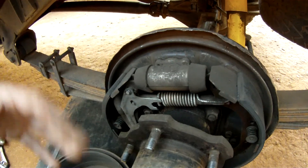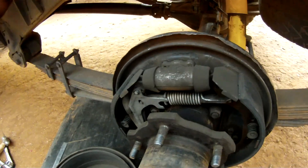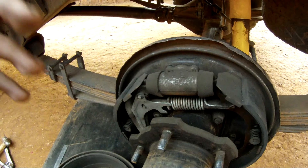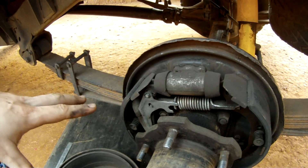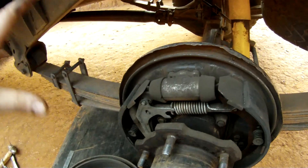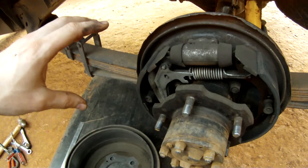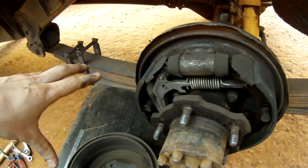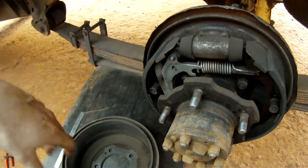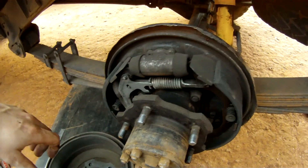When they work well, they're really good. But they don't cool themselves as well, and they're not so good after they've been through water. Maintenance-wise, they're just pretty poor. Calipers, as fitted on the front axle, are brilliant because they're just self-adjusting. Same sort of situation as with the suspension really — the front is really good, well designed, good. The back just leaves something to be desired.